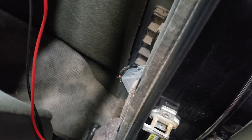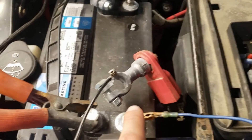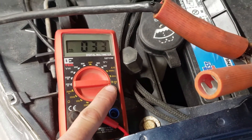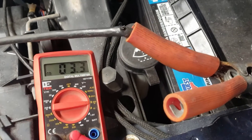Ultimately, this is why it was so challenging to find: this truck had a relay system installed for an overhead light that is no longer in use, but the relay is still active. All I have to do is disconnect that relay and all my troubles should go away. The fuse is hooked back up and the suspect relay has been disconnected.